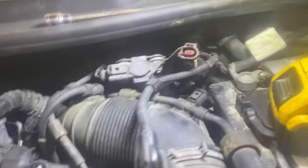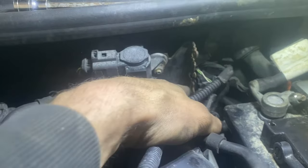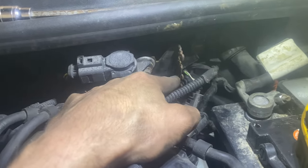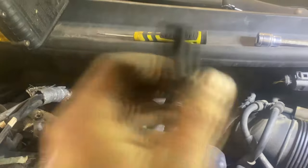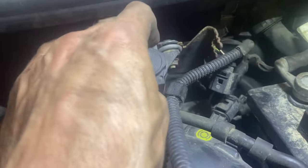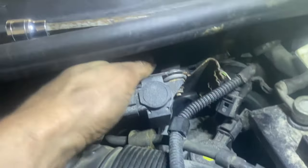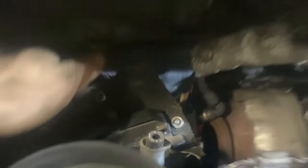I don't want to undo them up here because threads often come out with them. The group of three: the bottom one is the O2/lambda sensor, there's an orange EGT sensor going with the DPF, and a black one for the pre-turbo EGT — that one stays. There's also a red or brown one in behind. Once all those are unplugged, fish them over so they're just hanging, then get the differential sensor off the rubber pipe. Now we're ready to get this DPF out.